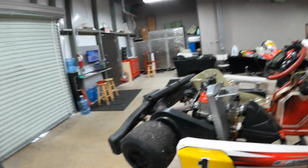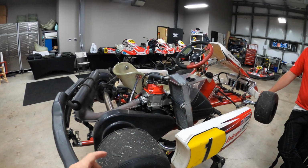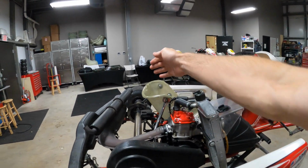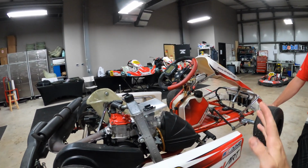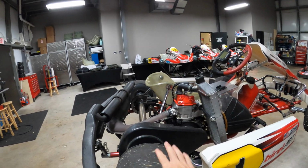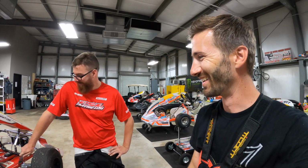Right, because it is a fixed axle, like a welded diff, these always turn the exact same way at the same ratio. There's never an opportunity for one to turn faster than the other, even though the outer tire goes on a larger radius. So if they pick up one tire, it essentially allows it to slip and get that rotation done. I don't know if I'll be able to pull that off today. I'll try, but I know it takes a lot of grip, a lot of G-forces and a lot of talent. We'll see if we get you on three wheels or not. Either way, this is going to be awesome. If I leave here with all my ribs intact, I will be very happy. So will I. All right, let's go drive this thing.